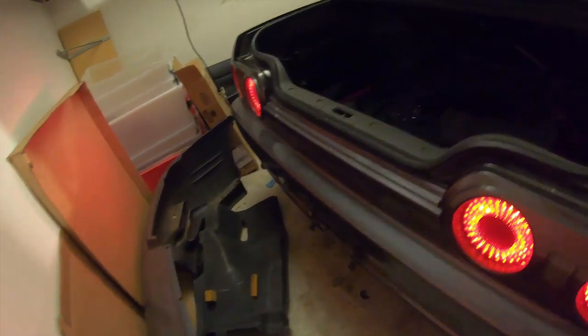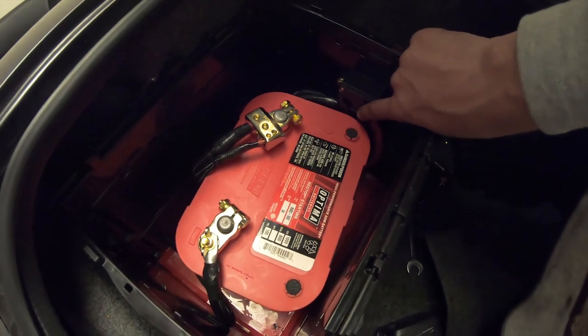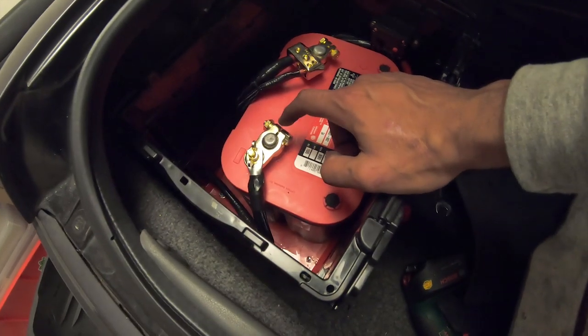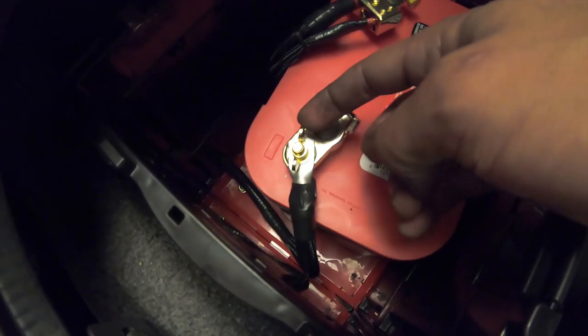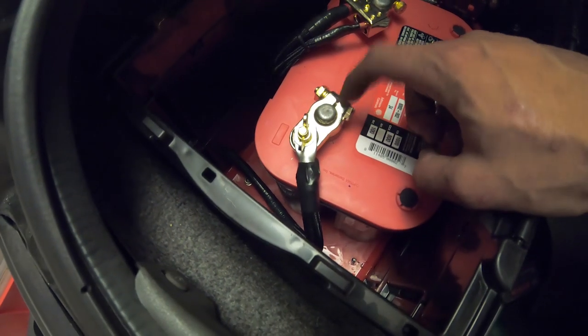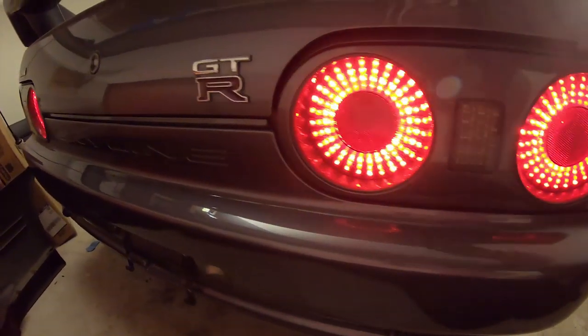We have LEDs — I would call that successful. I do have one or two small changes: I've got the wrong size negative terminal, so I'll flip the circuit breaker so the battery isn't powering anything. That's not a big deal at all because the wing nut comes off and all I have to change is literally just this terminal here. I just need to get a smaller sized negative terminal because this one's loose even though I've got it cranked all the way down. That is the battery relocation done, as cleanly as possible, without a massive battery box or unsightly wires everywhere.